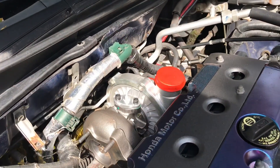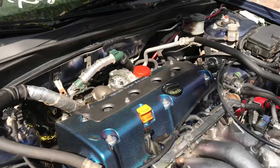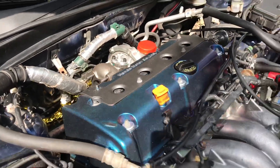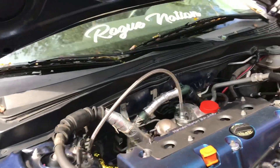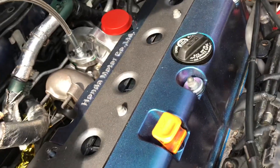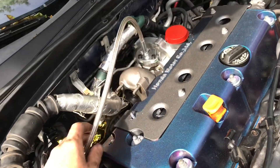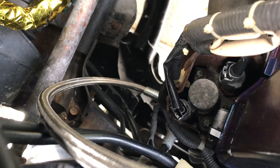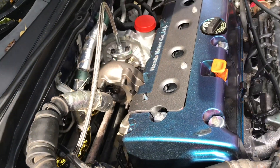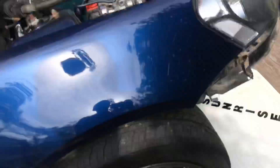So I'm not going to be having AC. I'm about to test fit where the drain line goes so I can mark where I have to drill the oil pan and put the fitting in. Now we have the oil feed line on — it's a little long, I'm probably going to run it over and across this way just to keep it low. I've got the oil pressure sender unit, the one for the oil pressure gauge, and just the line down there.